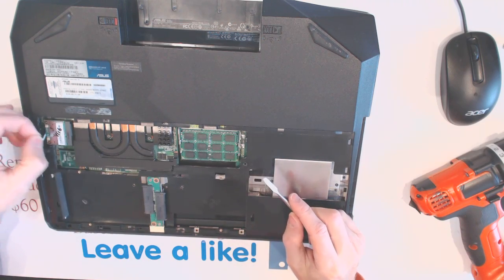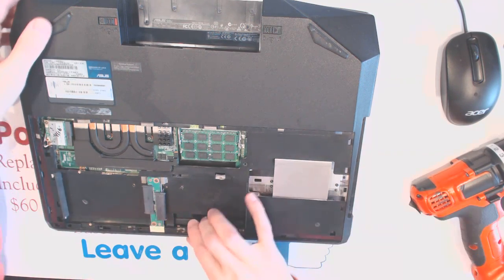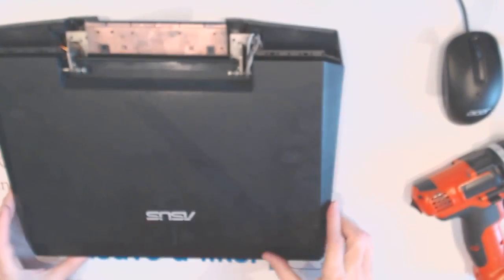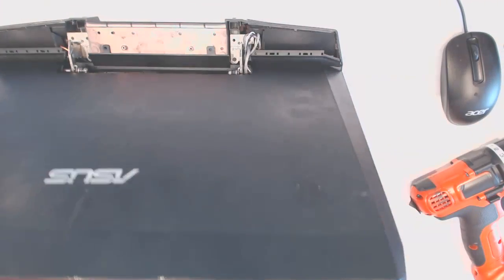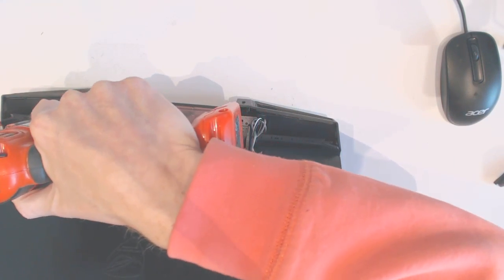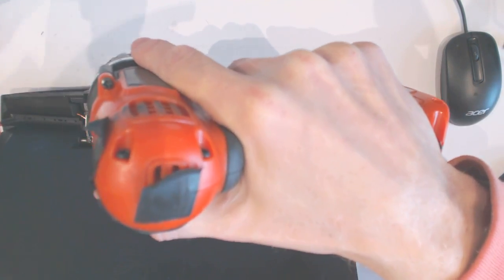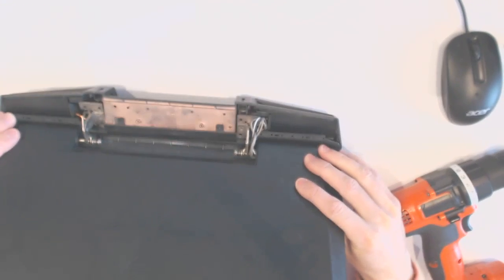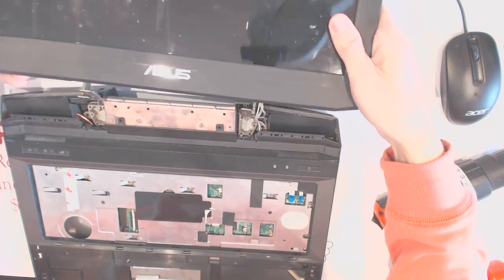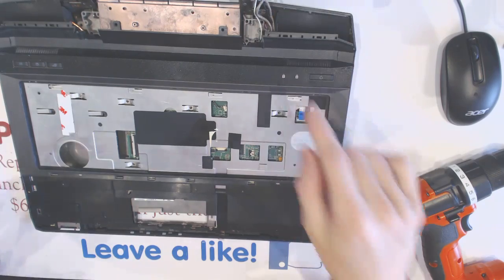Right, disconnect the 2 cables right here because you will need to pull them out of there. And now you want to flip it over. Like that. And now is the time for you to disconnect those 2 screws right there. Right now, carefully slide the hinges like that. Flip this whole thing forward, and let it rest like that. Don't put any strength on the cable.